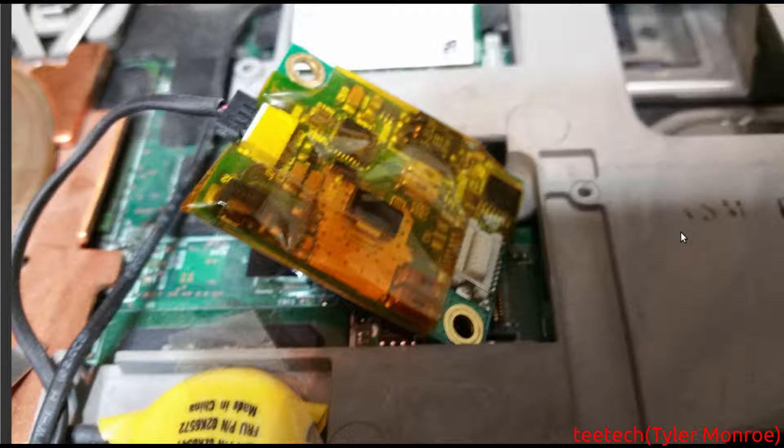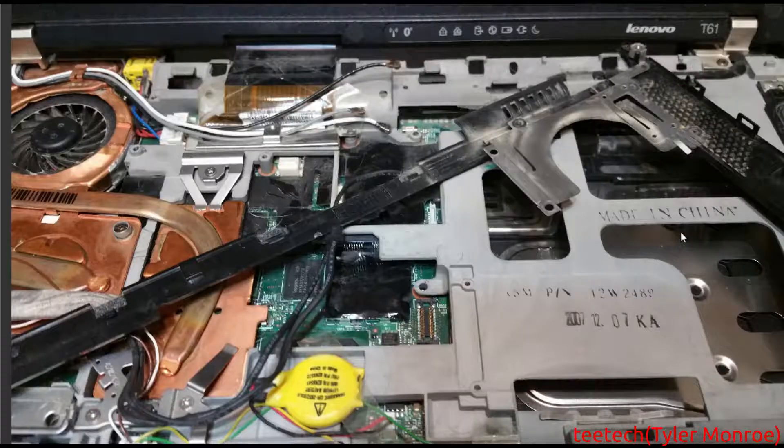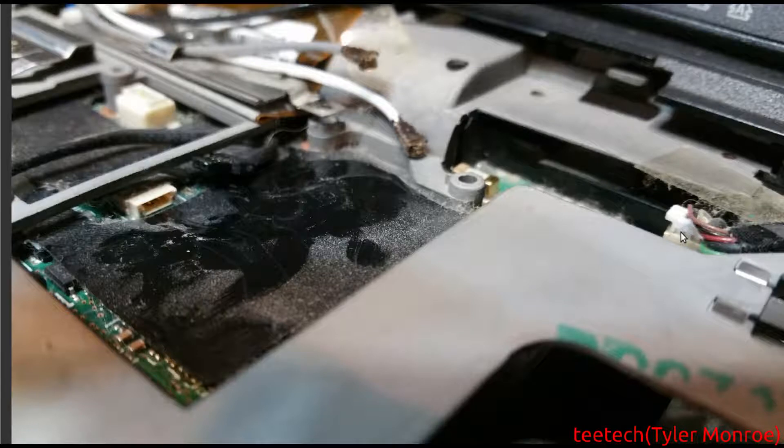After you get those things off, you move into removing the modem. I think it's like a WiMAX modem, but basically it's the modem. You want to take it out — you undo two screws and you can pull it right out. Actually, these are not in order. But after you take the keyboard out, you can take the bezel off on top of where the bottom bezel was. After I had done that — because I didn't do it in the exact order — that's the modem and the Wi-Fi card out of there.